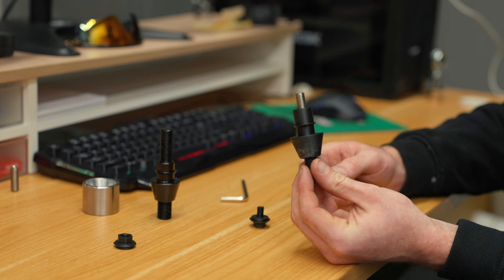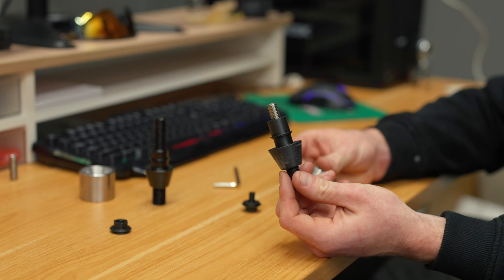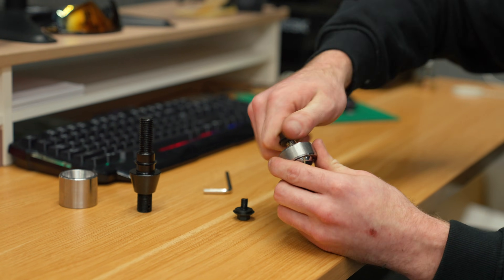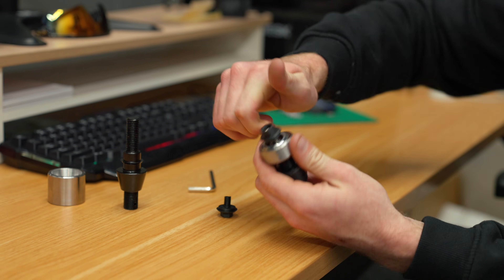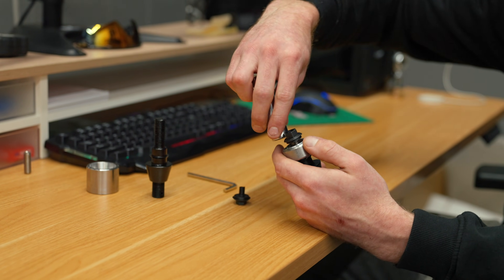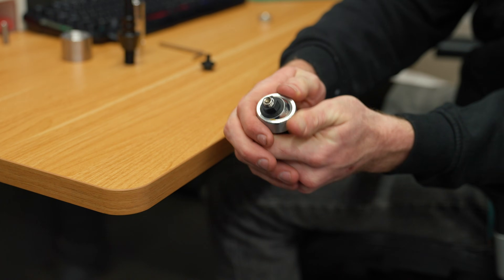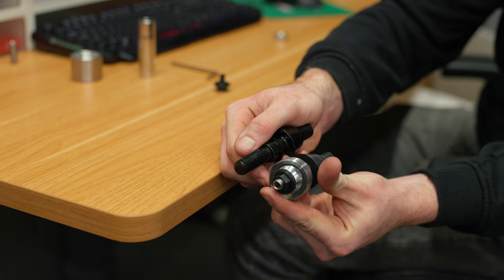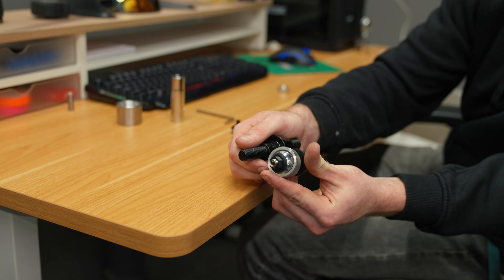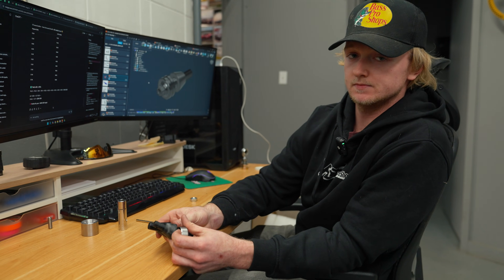We also noticed the tapers of the 370 and the 350 were actually the same, so we were able to make a one-piece fits-all situation. It gives you way more room for lowering your car or just suspension movement in general, and it's super easy to install — thread your set screw in like this, go in till the bottom is flush, 14 mil right on top, thread it all the way in. With that you still get full range of motion with your bearing and you're roughly an inch shorter, so you get more clearance and more travel.